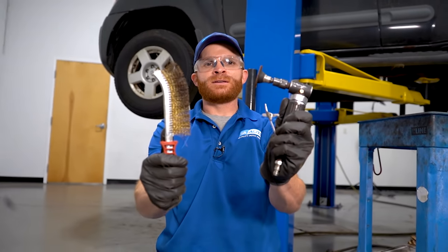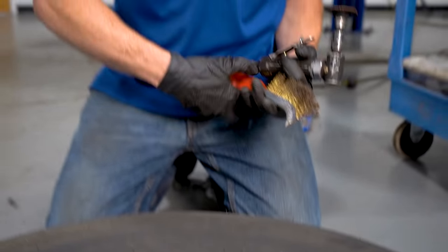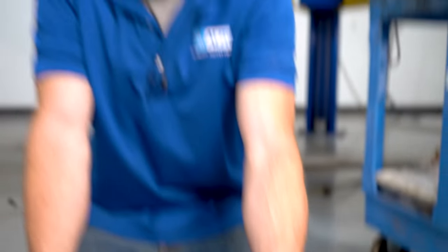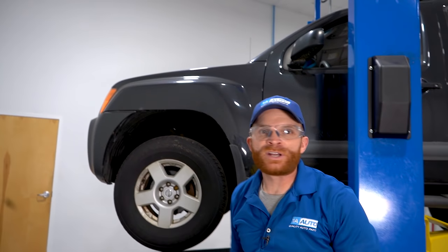People are more than likely to try something like a brush and try to rub it right on the wheel. Of course, that's going to cause some metal issues itself — it's going to scuff up the coating that's supposed to be on the wheel and protect it. Something like a wire brush is not a good resort at all — it's more for grinding down metal when dealing with brakes. The way I would go about properly fixing this would be to break down the wheel: take the tire right off of it, gently sand everything down so it's nice and smooth with no old coating, and then recoat it with something I like. But on a truck like this, I'm really not that worried about it.